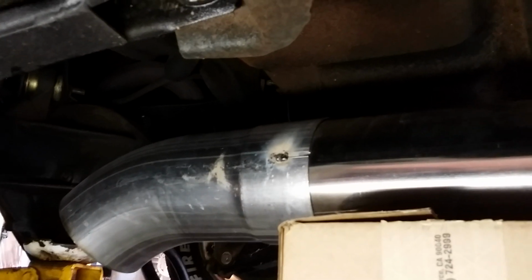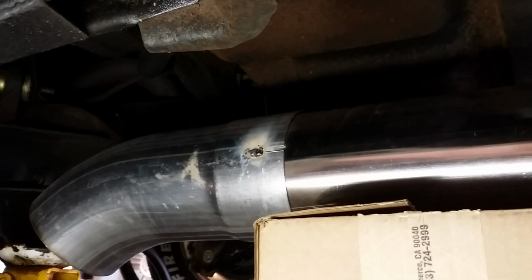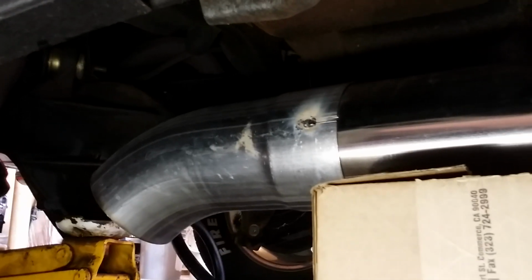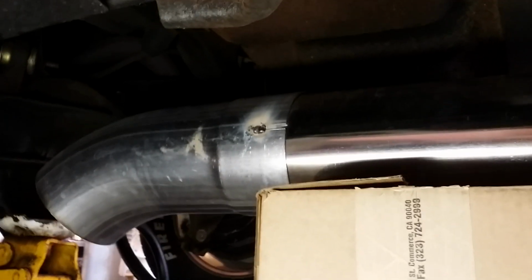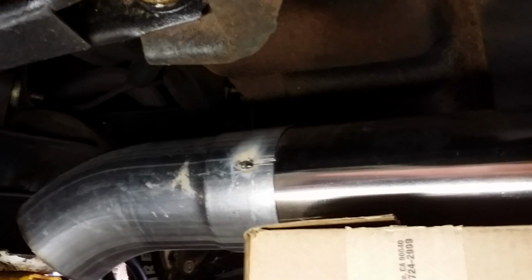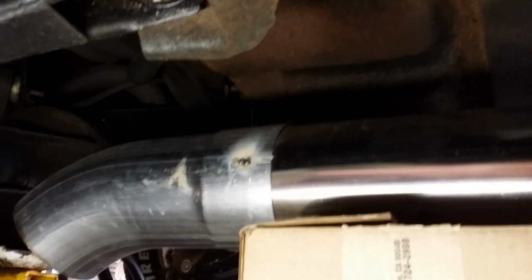By the way, the stainless rod I'm going to use is Eureka 505 stainless rod. It flows really nice, unlike a lot of other stainless rods like a 304. They're very difficult to weld with. The Eureka just flows beautifully. You can basically weld any kind of steel to any kind of steel, whether it's tool steel, mild steel, any kind of steel. The wire that I used to tack this together was a flux core stainless MIG wire, and that welds like total garbage. Some of the worst wire I've ever used, but it's okay for tacking.